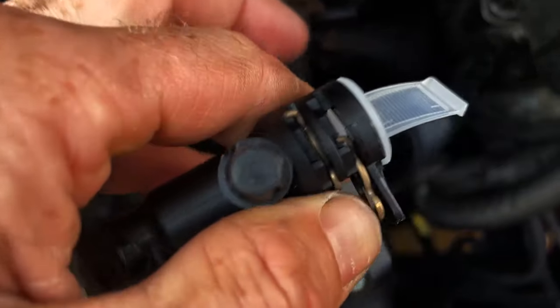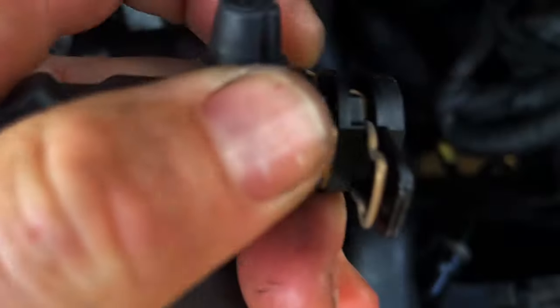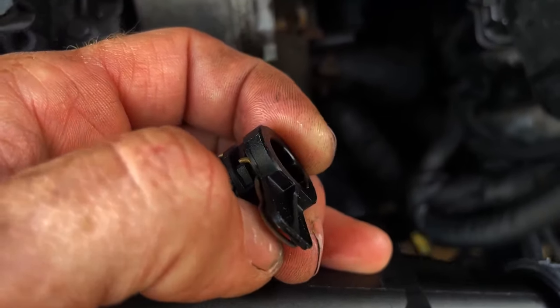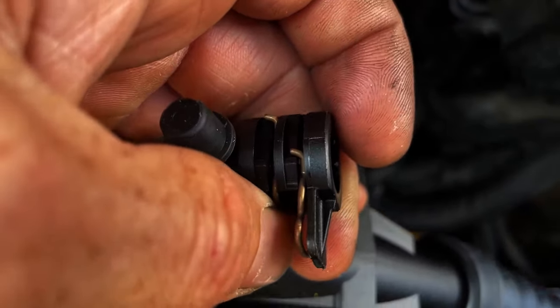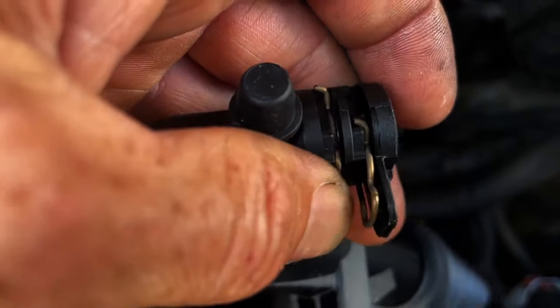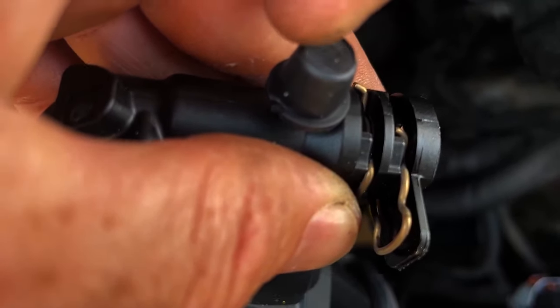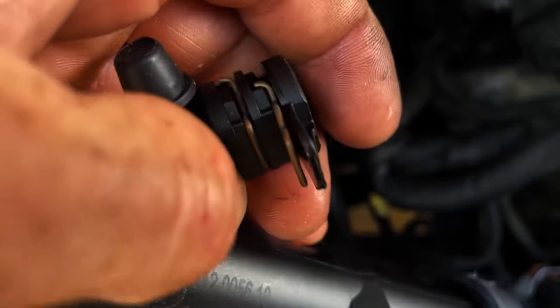This is the profile we need, so I exchanged it — 27 pound this one. We'll get it all in and then I'll show you how to bleed the system so there's no air in the new cylinder. Before we put this in, when the cap comes off this tap cover will come off. You take both pins out, put the clutch and brake fluid nozzle in, close one of them, then pump the clutch until the fluid starts coming out of this hole. Then you know all the air has come out and you secure it by clipping the other one down.